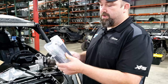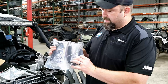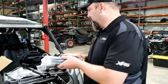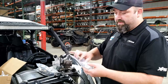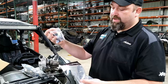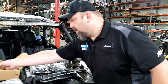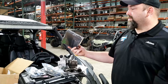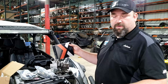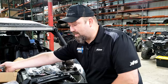We have a larger fuel pump — when you're talking about making upwards of 300 horsepower, the stock fuel pump just isn't going to cut it. You'll get everything you need to run the bigger fuel pump. More fuel from the pump means we need a nice billet rail with some larger injectors, which is really nice to have. You've got to have this if you're making 300 to 345 horsepower. To control all that, they have a map tuner set up with tunes from basically 2 to 5, and they're going to run E85 most of the time — so this thing's going to be making 345 horsepower to the crank. That's a lot of power.